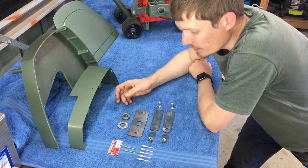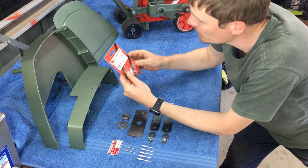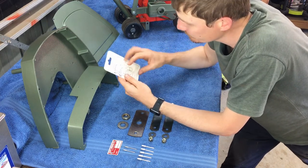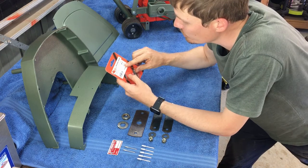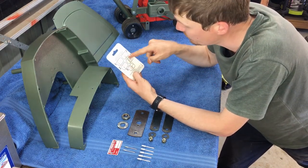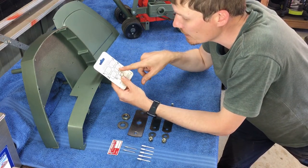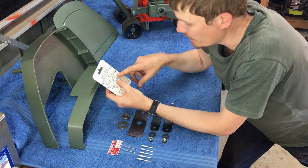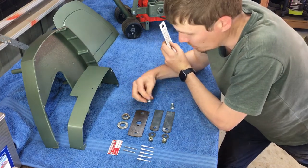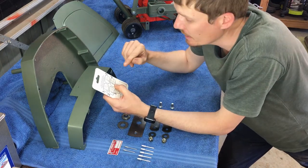So basically I've gone and purchased brand new blades from GA Spares. They come in this little packet. There's a part number BBN441. On the front here it says use fitting instructions number 4. So on the back of this little page there's five different ways to install these. So we're using number 4. I've already looked at that. Basically that is just the bolt, the blade, a flat washer, and then a nylock nut. So really is not a great deal to that.